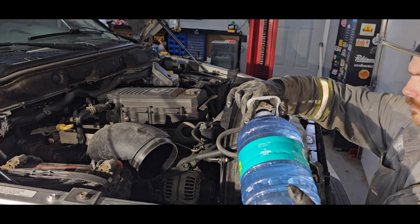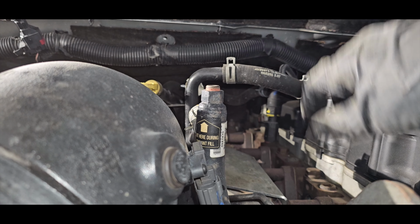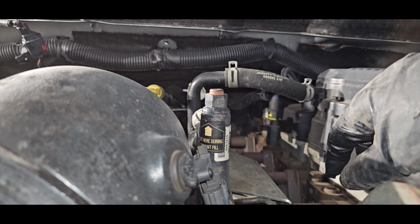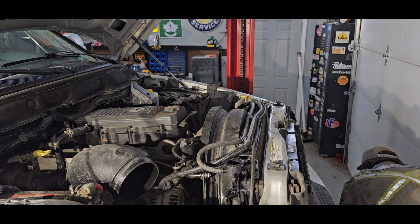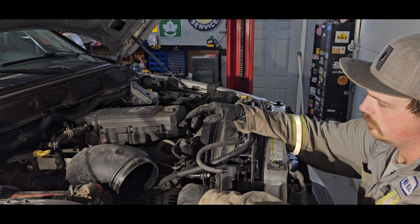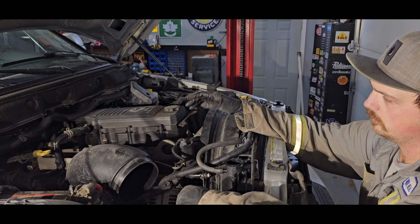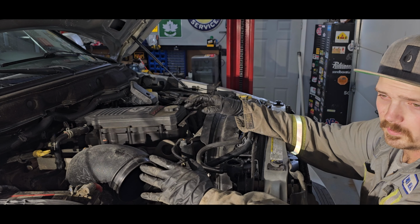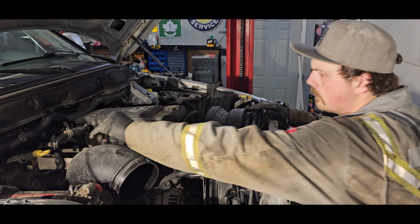All right, so while we're filling with coolant, we're going to open the vent here, to let any possible air out of the system. Turn over a few times, make sure any entrapped air that could be somewhere within the system comes out, and then we are all set. All right, so first things first, we'll close our drain off the pan. So close, okay, and we'll talk about glycol. The system holds 21 liters, but since we didn't drain the block out entirely, I know that there won't be 21 liters going in. So we use the coolant first, and then we'll top out the rest with water. Our ratio will be more than 50-50, but I'd rather have high enough coolant versus water, so we should be all right there.